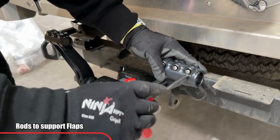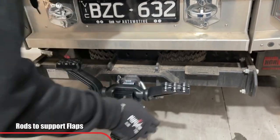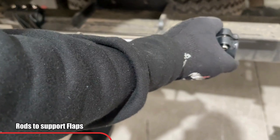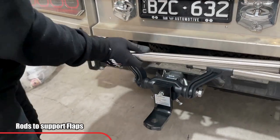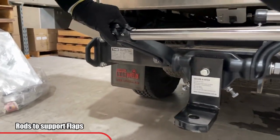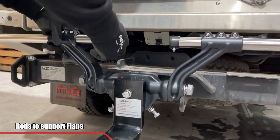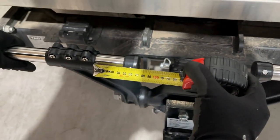Apply the bolt bumpers over the bolts. Now install the support rods — with an allen key, slightly loosen the arm clamp bolts and slide your support rod through. These are adjustable to the length you need to suit your vehicle. The holes on the support rod are made to suit different vehicles: the first for small to mid-sized cars, the middle for full size, and the furthest for larger vehicles. Ensure the length of the rods are the same, then re-tighten.